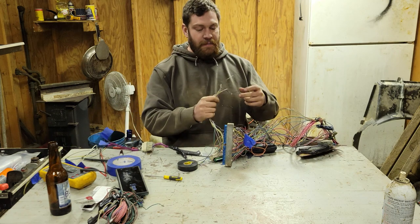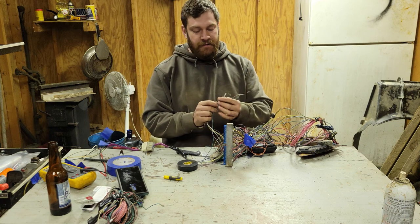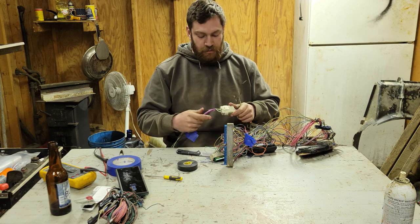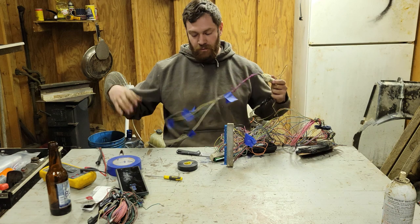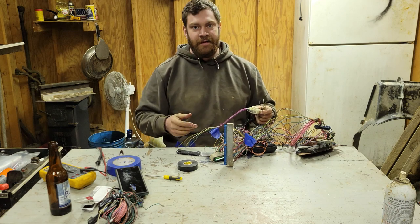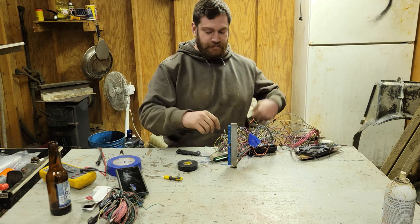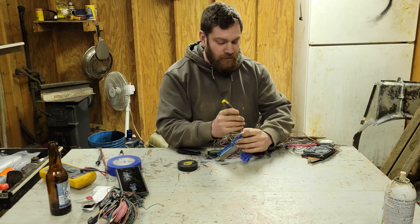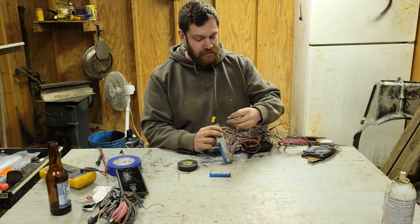And I'm going to go ahead and repin the harness, because every one of these have an ECM pin on them. And then I will have a waterproof actual connection to go to everything on my dash or wherever it needs to go. I think that'll be a lot more handy than, you know, just singular wires like I was going to do. So same thing as whenever you're depinning, because that's all we're doing, you're going to take that off. This one I already have marked out.